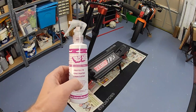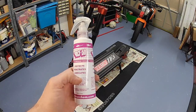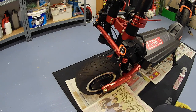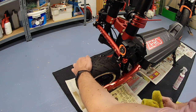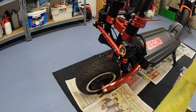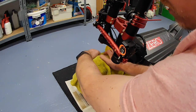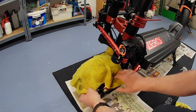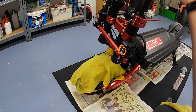I've filled about a third of the bottle from the main bottle. All I'm going to do now is put cloths over the areas where I don't want the ACF 50 to go. Basically I'm looking to keep ACF 50 off the tires and the braking surfaces — so the calipers, the pads, the discs. We'll also cover the handlebars since we'll be doing up the forks and the main stem.